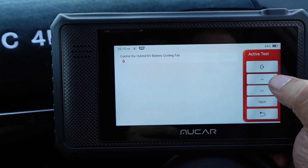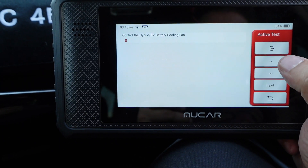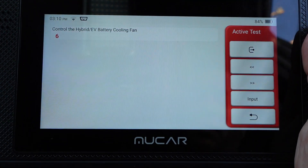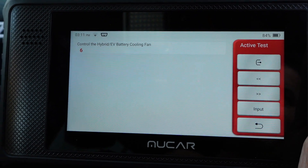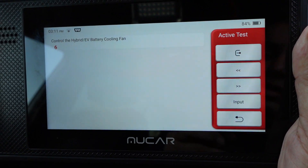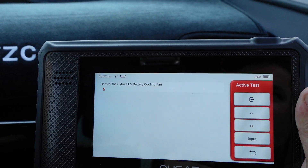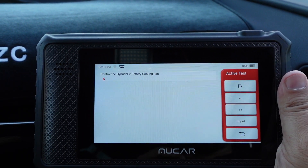Check this out — I'm actually under the high voltage battery fan right here. A lot of the first hybrid vehicles that came out were burning up because people had dogs and the filter on the fan would get clogged. You can actually go ahead and activate that right here. If I did this test and that fan wasn't turning on, it would let me know that the fan or the connection has something wrong — I don't have to tear the whole car apart. That is pretty impressive, and this is one of the main benefits of the bi-directional scan tool for the everyday user.